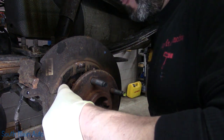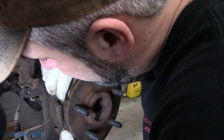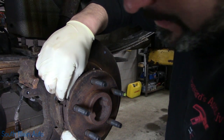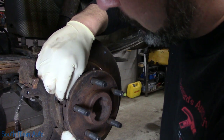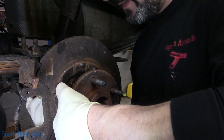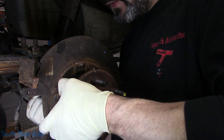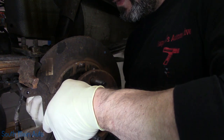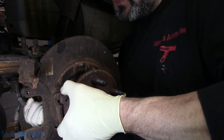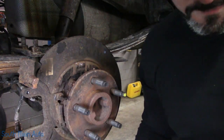Once it's off, we want to make sure our parking brake mechanism is free — just make sure it pivots on that lower pin, which this one does. This one works freely. Now if you reach back here and pull the cable, there's a good chance that you'll unhook it, and these are a real pain to hook back up. So try not to unhook it, but make sure that it's as free as can be — this one has real good movement. We'll leave that alone until we're finished.